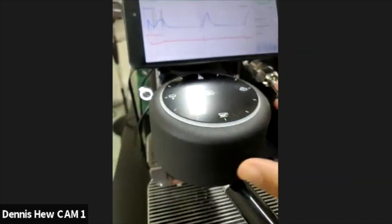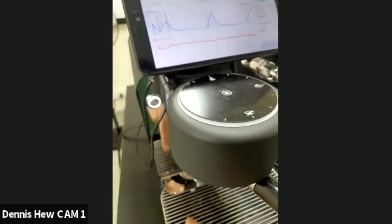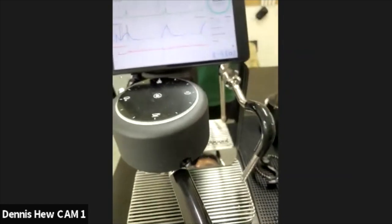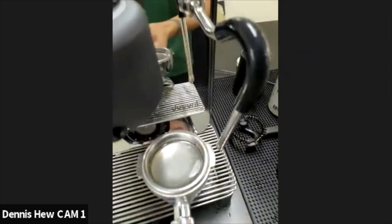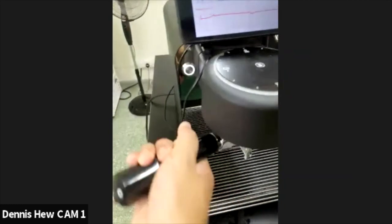Yeah. So a lot of things are inside of the pathway, inside of the group head, and the brush cannot brush them off. You can't see it. So that's why you need to have a pressure build up to flush everything out along the way. So it's getting clearer. So one more time should be just nice.